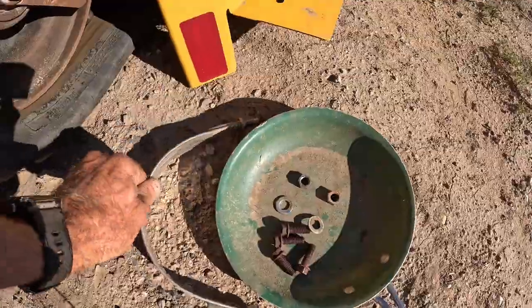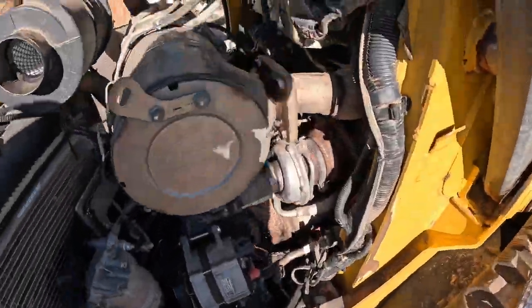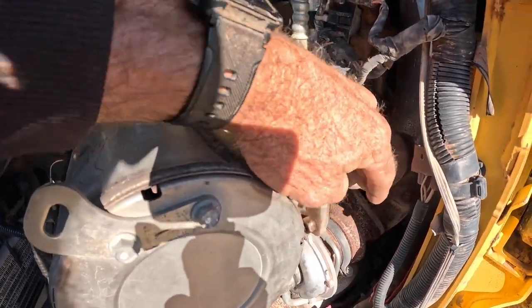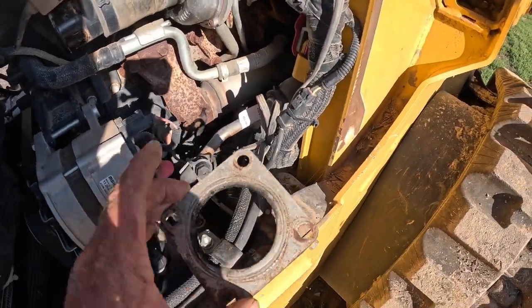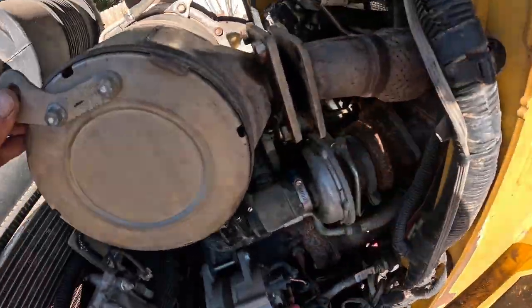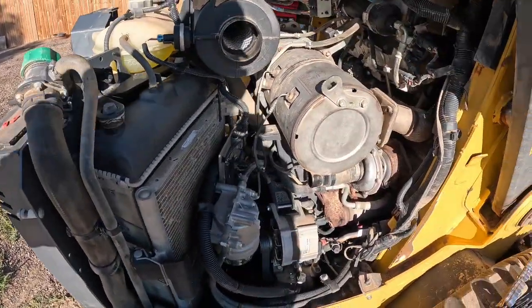I like to keep all the parts from one side of a vehicle in their own container — easier for reassembly. These four bolts here, with my favorite lubricant, because it's exhaust. Well, there's a gasket — let's not lose that. And I believe we're ready to remove it, and we'll try cleaning it out.